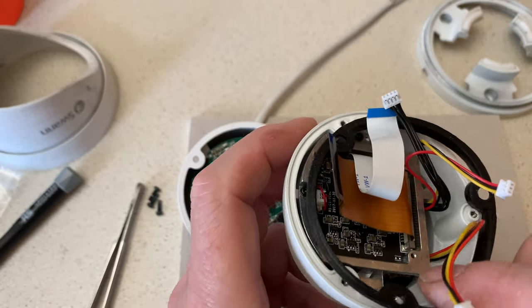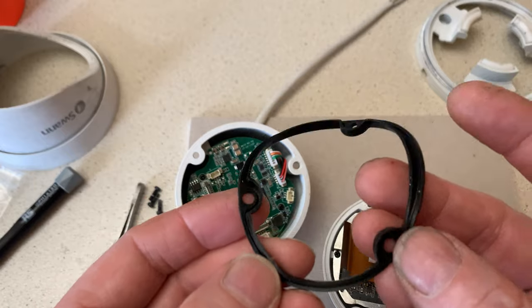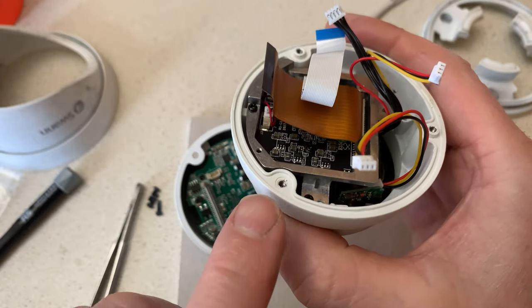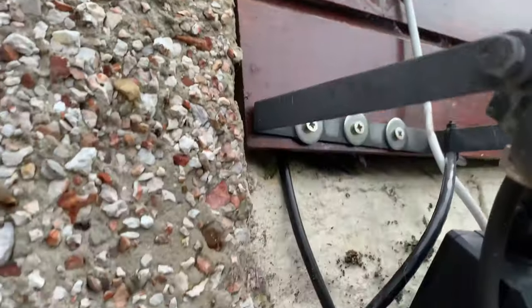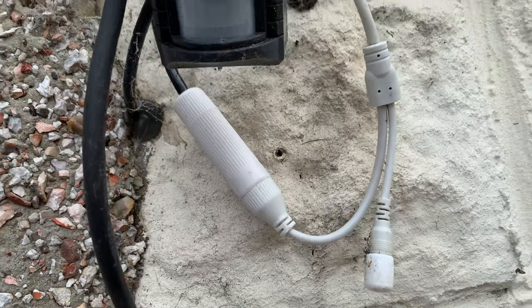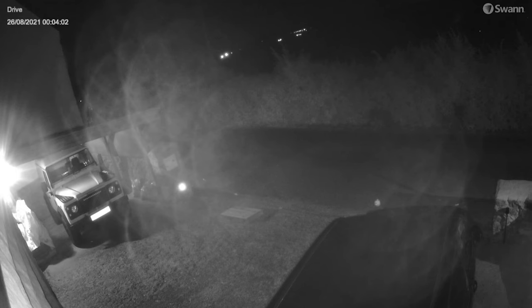One thing I will say before you dismantle your own and put it back together — the gasket, it doesn't matter which way round it goes, but there are two holes here which is different to the smaller hole there. That's because on the camera body itself there are two pillars sticking out and the third one's flat. So just make sure you get it the right way round. Right, there you go — all back together, should be functioning quite well now. Certainly with a clean lens we've removed this cataract. I've got to put a bit of self-amalgamating tape around here where the network cable comes in, but apart from that it should be done. Hopefully by now you'll be seeing on screen a before and after — not a vast difference but the clarity is so, so much better than it was, particularly when the sun's shining on it. I hope you found that interesting; if you have, feel free to subscribe or give me a thumbs up.